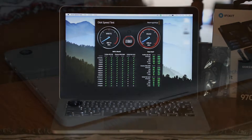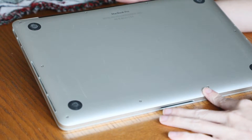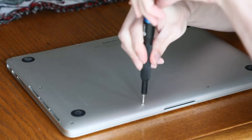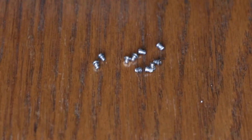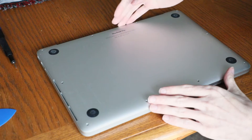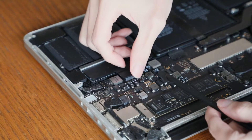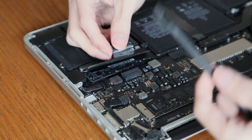Let's shut it down and swap it out. After flipping the MacBook over, use a Pentalobe 5 screwdriver to remove the 10 Pentalobe screws on the bottom of the machine. Keep in mind that the two located by the heat vents are a little shorter, so be sure that you're putting all your screws in the proper holes when reassembling. The case screws are very small, so do be careful or use a magnetic mat for retention. Once all screws are removed, simply use a prying motion on the back panel to lift it up and away. The next step is to remove the adhesive next to the power supply and the battery, then remove the tab connecting the battery to the machine. This can be done with a spudger or by using a fingernail.